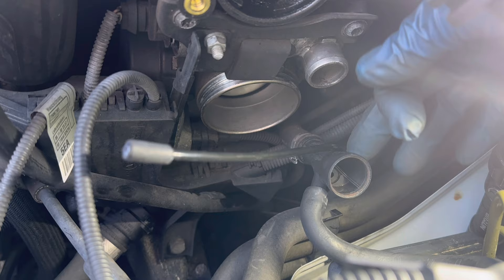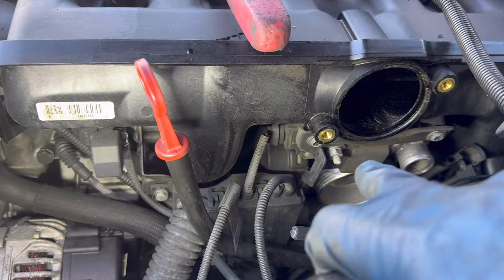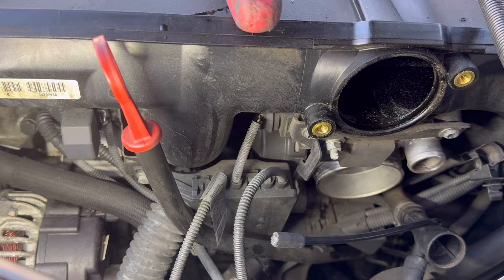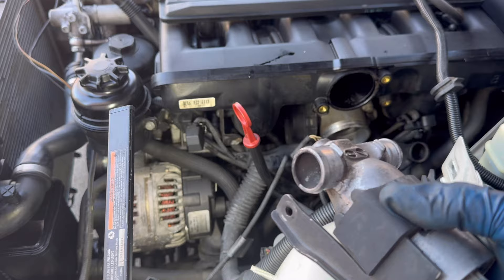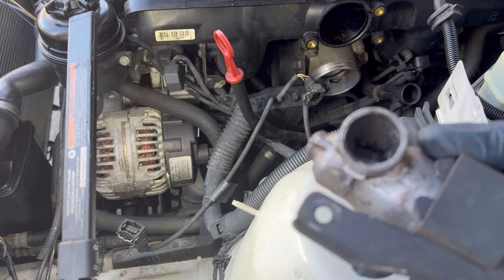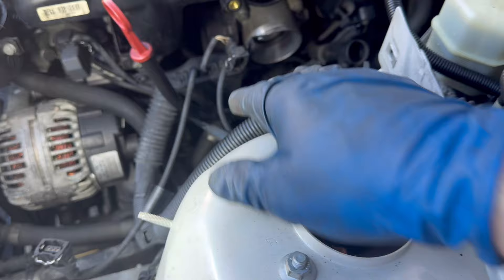Here's your ICV, your throttle body where the DISA goes. That's going to have to get replaced since it broke — just the fun of dealing with old plastic. Next step, we're going to start taking this bracketry off from the electrical distribution, then get access to take the ICV off and the throttle body off. Got this all unbuttoned, bracket off the ICV, ICV out of the way. When you have the ICV out, it's probably a good idea to clean it. You want to hear it rattle — if it doesn't, it's stuck and can cause idle issues.